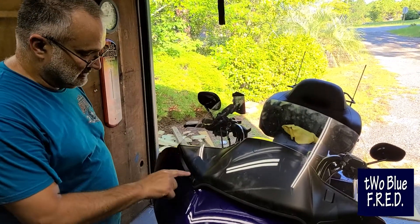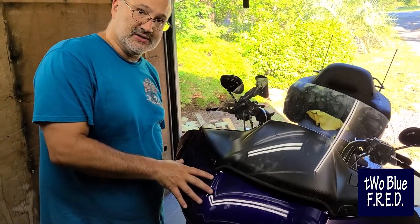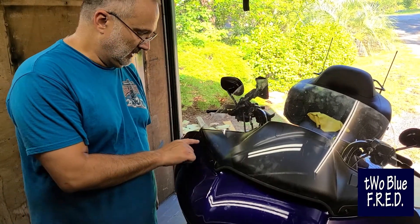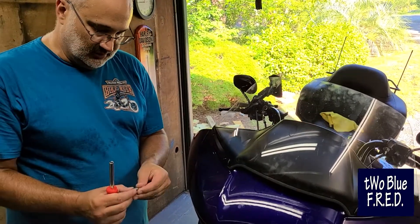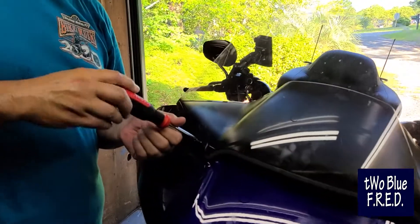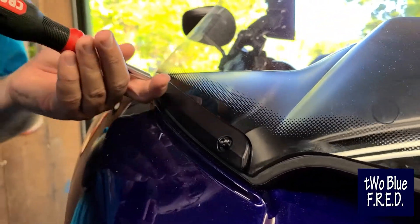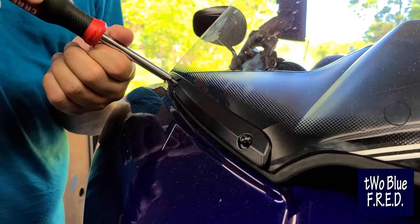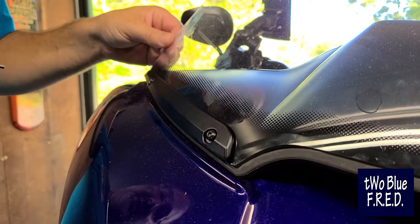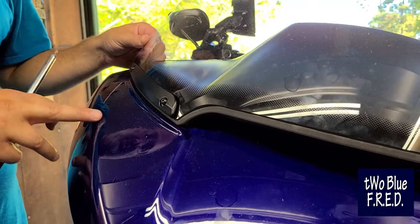Up here on the front you've got these little black covers that hold the windshield against the cowling cover. There are screws behind it, so it's part of the assembly you've got to get off. These take the one-eighth hex nut, and you're going to loosen them — not take them all the way out — just loosen them a little bit. The windshield has some slats, and once you get it loosened it will actually slide out without you having to remove the whole bolts, which keeps you from dropping screws onto your paint.